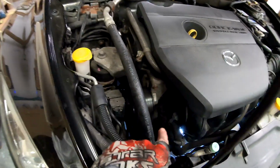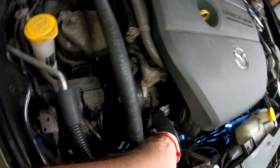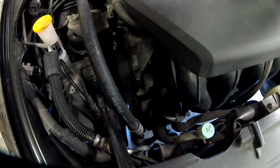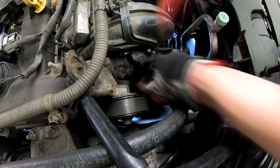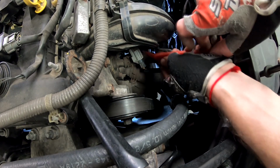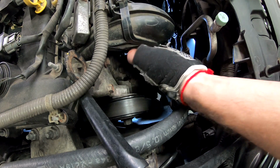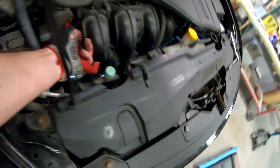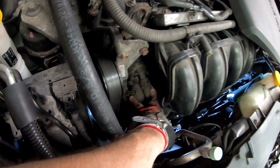Alright, as that's draining, now we need to get to this. So let's remove this plug. The press tab is there. And this, let's put the cover on the side. Or we can just unpin from this and then just put it deeper inside. Nothing unplugged. I just moved it from its brackets with the trim removal tool. Just pry it off from the brackets and push it back in. So now we have more access to the thermostat.